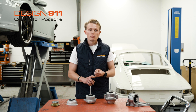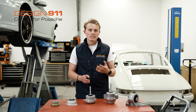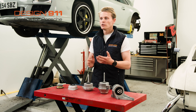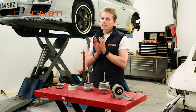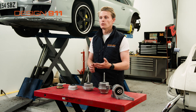In addition to the vibrations and the bumpy ride or rocky start, you may hear noises come through the car. This is similar to the noises generated from worn suspension components. If you're driving along and hear knocking noises, it could be coming from your suspension, but it's also worthwhile to check your engine mounts, because that is a sign of a worn engine mount.